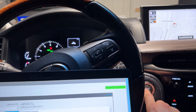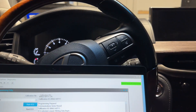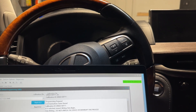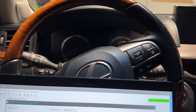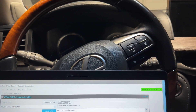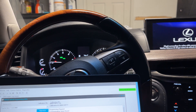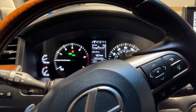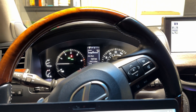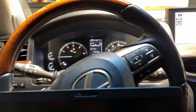Let's go ahead and start it. Hold the brakes, hit the start button. That just cranked and cranked — nothing started. Let's try one more time. I didn't really turn it off, huh? I should have turned off the ignition first and then started it. Now the ignition's off — let's start it. There we go. So anyway, at this point we've got the factory tune flashed back on this guy. I'm so amazed that VF Tuner has the factory calibration tune for the 2016 to 2021 LX570s already preloaded on their software. That's awesome, that's really good. So that gives you a place to start.